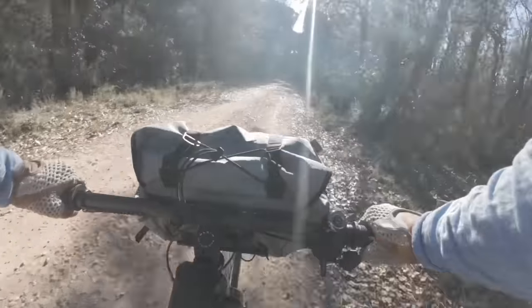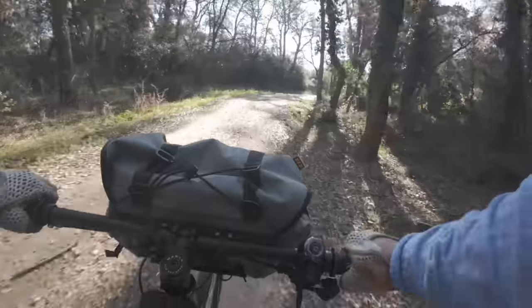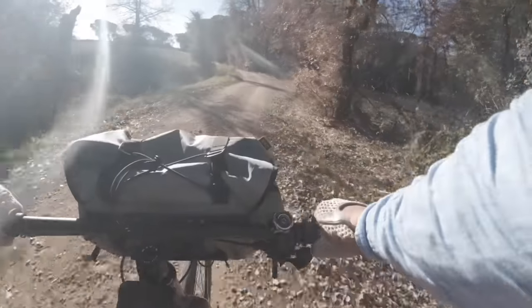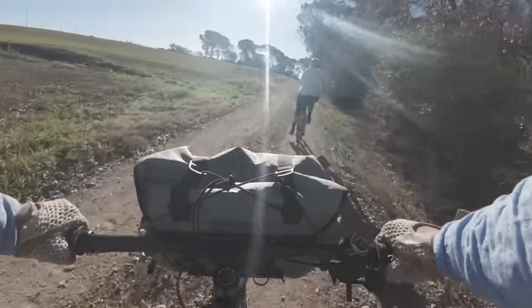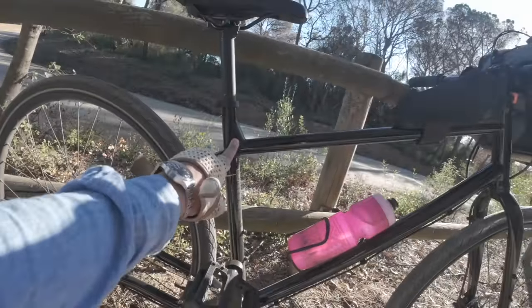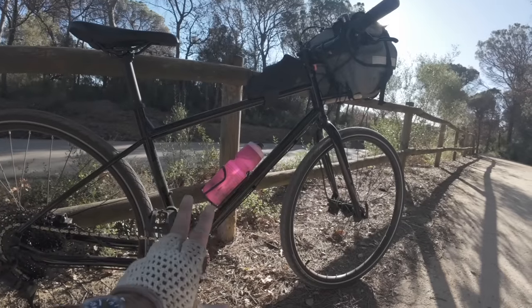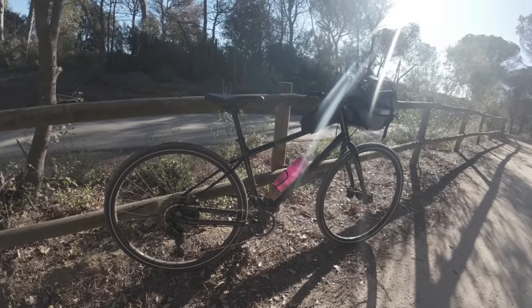I put the camera back on the chesty this time without the DJI Mic 2, and hopefully there's an audio difference. There's not only wind from the descent, we've also got a pretty good cross breeze. And what else is a breeze is descending on this Marin, because of its relatively slack head tube angle and high trail going down chunky stuff or double track. I pulled over really quick so you guys can get a better view of the bike. Steel frame, steel fork, some heavy gusseting going on in the rear. The head tube angle is slack — I think it's like 67.5 or 67 degrees. Rear end is a little bit on the longer side, and what this means is it adds up to a super stable riding bike. Downside is slow-speed climbs — the front end can get a little floppy.